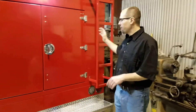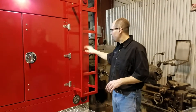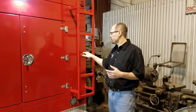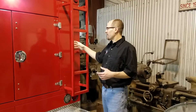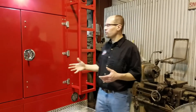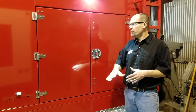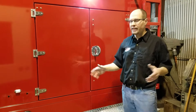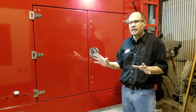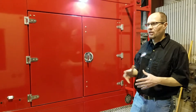This is an aluminum style truck — everything you see is aluminum or stainless steel, with the exception of the ladder, which is steel because we couldn't find a narrow enough stainless steel option. The entire truck is powder-coated, which is nice because powder coating, as opposed to paint, doesn't chip when you nick it — it just dings. It's much more durable, like a plastic as opposed to a hard enamel.